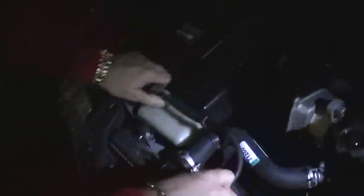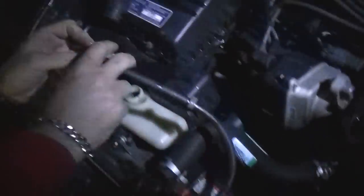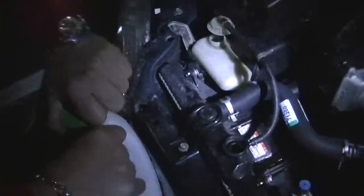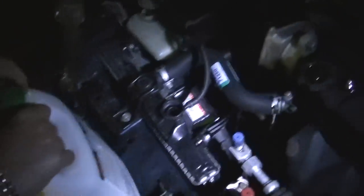Don't we need to fill it up with more fluid? Well, I need to check and see what's left — if there's anything in here. Can we put some light in here? It's pretty much empty. So we're going to pour some in here first and then fill the reservoir. When all the fluids come out of the radiator, the first thing you want to do is prime the radiator itself with fluid before filling up the reservoir. That'll make sure it's not running dry while the fluid's being pressurized into it.